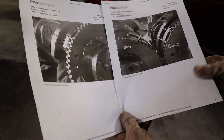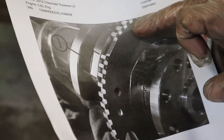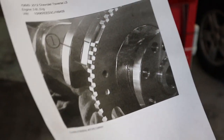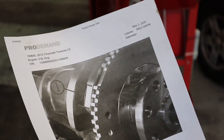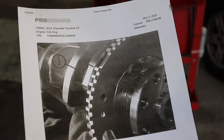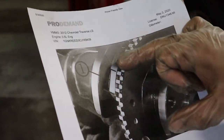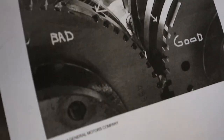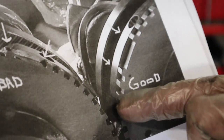The issue is that this is going to be your crankshaft, and in the crankshaft there is the sprocket — the pickup sprocket for the sensor. The issue is that this sprocket moves out of position on the crankshaft, so now the crankshaft position sensor is going to be picking up a wrong signal because the sprocket is not going to be in the correct position. You've got to make sure that the sprocket is located with the correct gap from the crankshaft. You can see that there are three teeth from the end of the lobe on the crankshaft — that's the correct position.